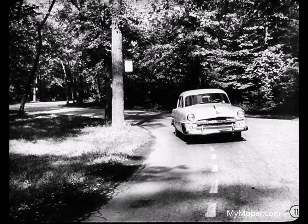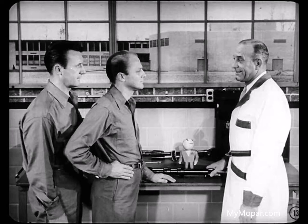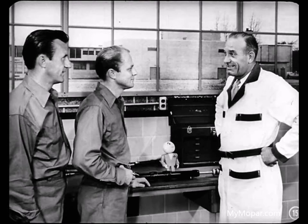The units are designed to take the effort out of steering. The driver still has the feel of the road at all times. The power steering units become operative whenever a slight force is exerted on the steering wheel. The amount of assistance given by the power unit to turn the front wheels increases in proportion to the effort or pull applied to the steering wheel. The driver maintains full control of the car with an average light grip on the steering wheel. But what happens if the hydraulic power fails? Nothing, except there will be a slight increase in steering effort over that needed for a car not equipped with power steering, but the car can be handled very well manually.